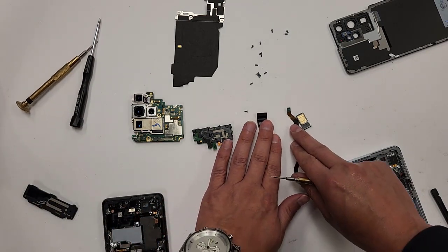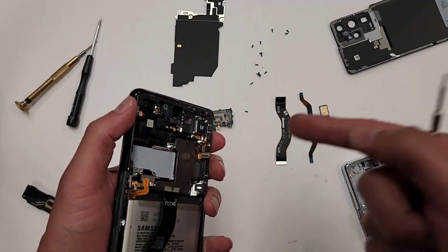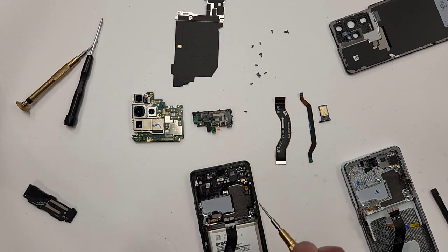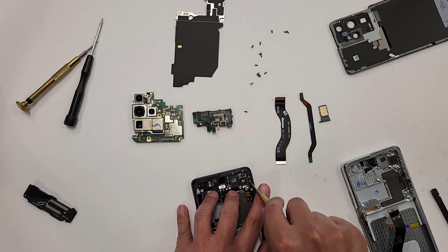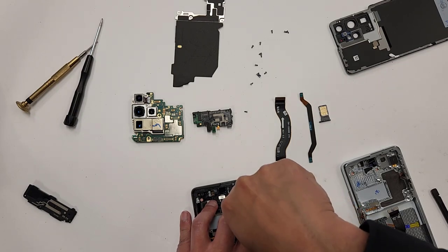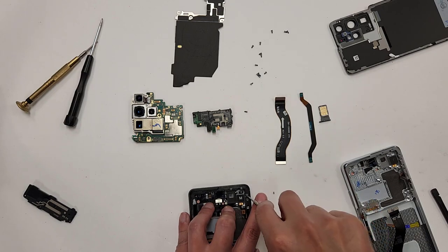And when you take this out, because I have done this before, where one of these screws strips and I can't get the screw out anymore, and then I gotta get a drill and drill the screw out, right? So what you wanna do is lay this kind of flat and put some pressure into it, and then you twist and unscrew it. So you don't strip the screw, right? Let's see. There's, I think, 1, 2, 3, 4, 5, 6, 7 screws we gotta take out. So I'll put some pressure down and then I unscrew it, right? So there's one.